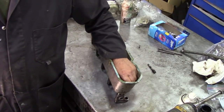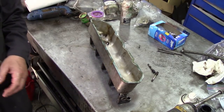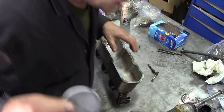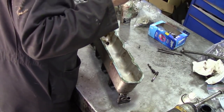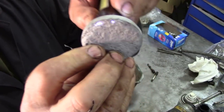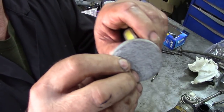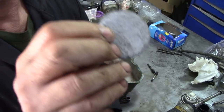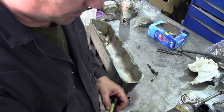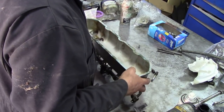While I'm doing this, I got a bit sidetracked — here I've got something to show you. If you can remember, I took the core plug out — or as Americans call them, frost plugs. This is the one I took out and I sandblasted it. Can you see the light shining through the holes there? See how rusty it was? Isn't that incredible? And look at the inside finish of that plug — absolutely diabolical. So that's why I always replace them. People say, 'oh you're wasting time,' but for the price, just take them out and replace them.